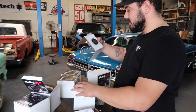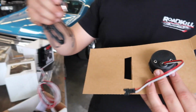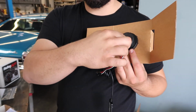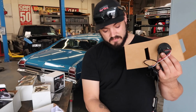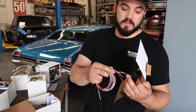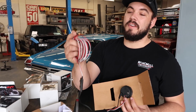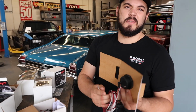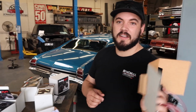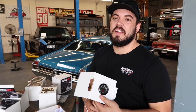So what do we have? Oil pressure, right? Oil pressure has two, what the kids call it nowadays, aux cords, or the 3.5 millimeter. You plug one in here, and then you plug one to the next gauge, and they all tie together, and you use this module, and plug it directly in with this white and black pinned wire. You're going to plug that directly into the Terminator box, in one of the pins. I think it's J16, but it might be 61, something like that. I'm a little dyslexic. But it's super easy to hook up. Super easy. I think I had them in like half a day.